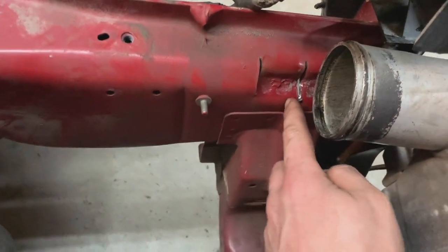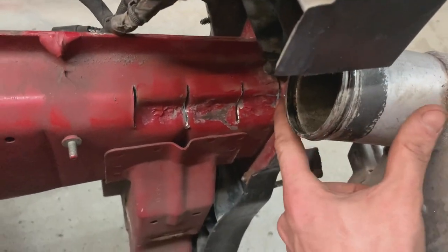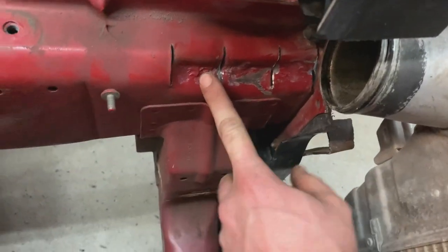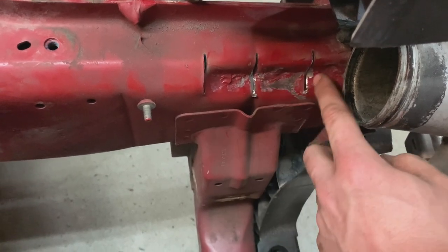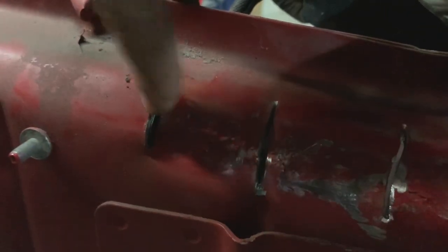So instead of chopping the whole thing out, I thought I might make slits in it in a couple of locations. So like here, here, here, so I could bend down a 2-inch tab rather than the whole unit, because this is thick. And then after, I can just kind of buzz that shut with the welder, and I can beat this piece here down and taper in and weld in there. So I'm going to give it a few more smacks to get it way out of the way for the rubber hose, because that's probably 3/16 thick, so I'll need a 1/2 inch for sure. So I'll smack some more of that out, weld it up. And I might actually get something done tonight.